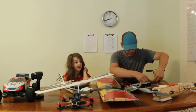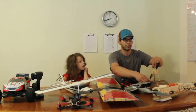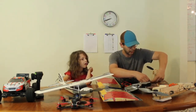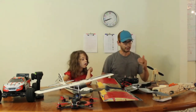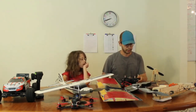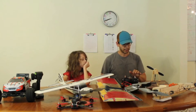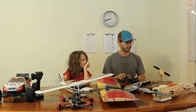I had to throttle down — it's usually good practice to not arm with props spinning, but I did this before the video started so it won't start up on me. The throttle down triggers a couple of beeps from the speed controller — that beeping was the speed control saying it's armed. Let me check the rudder — I do have it hooked up to the aileron channel, and that's working pretty good.